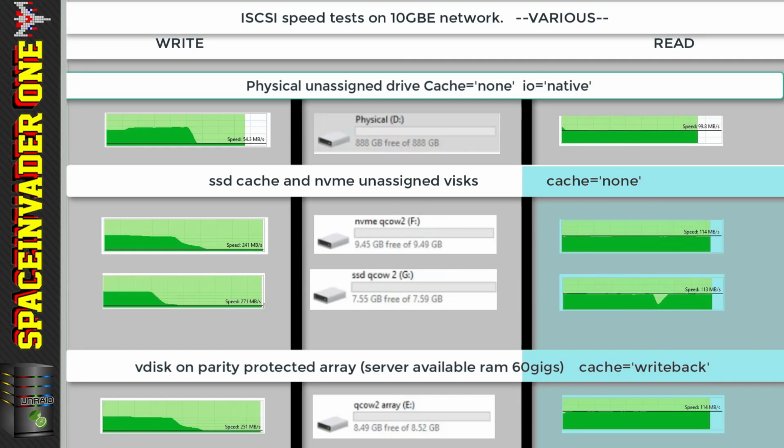However, I say read speeds, but what we must remember is the read speeds are also the write speeds on my client computer, my Windows box. It does have an SSD, but only a 128 gig one, so it could be down to the slow writes on that, although I would have hoped for a bit better. Now what I should have done was to set up a RAM drive on my Windows box, so there'd be no bottleneck that end. Anyway, this wasn't a video about benchmarks, it was about how to set up an iSCSI target.